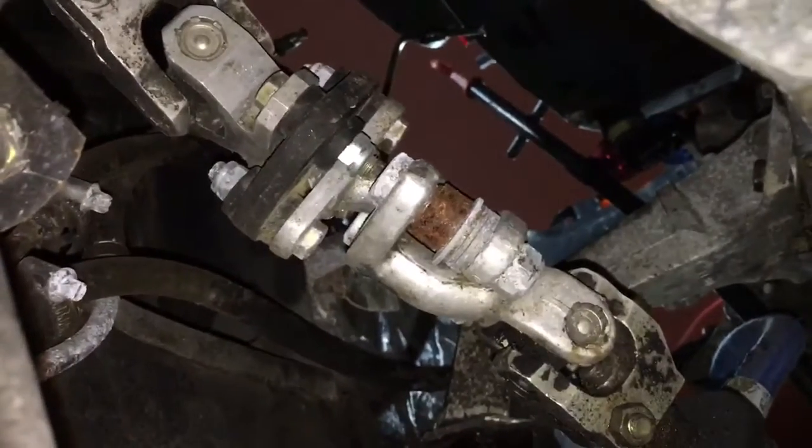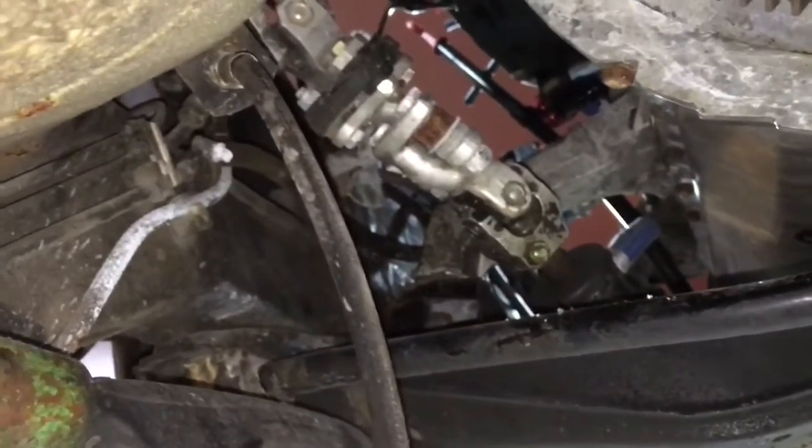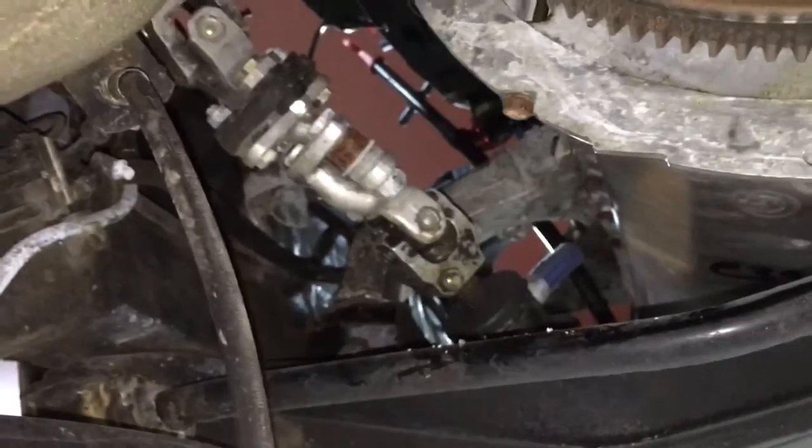Here's the custom-made steering coupler. There are better ways to do this, but some washers and bolts do work. You have to - I forget if it lengthens or shortens the run - to run an E36 rack on an E30. It's a very good mod though if you haven't done it, even on an M3 which originally came with a three-turn rack.